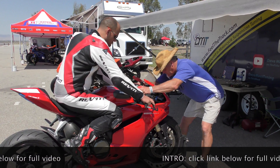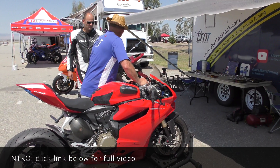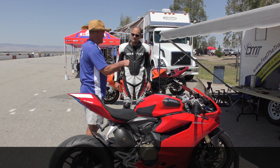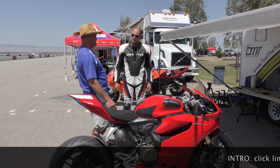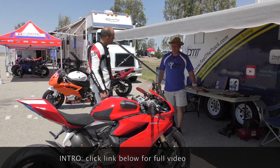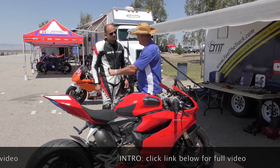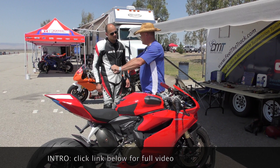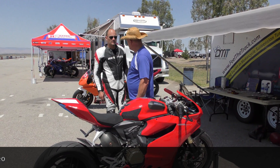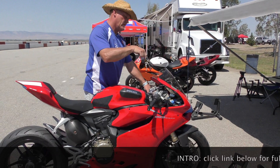Feet up for me. The front is extremely bouncy, so you have extraordinarily strong forearms. You're trying to hold onto that as you go through the corner, and when the corner ends you can relax. So let's fix that. Does that contribute to fatigue as well? Absolutely, 100%. Because you have to grip, it torsions everything, gives you numb wrists, pain in the back of your neck, and makes the deltoids very sore. Basically your upper body is doing the job of the suspension. You've seen the back go down, up, and stop — the front has to do the same.